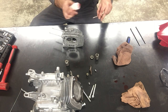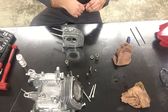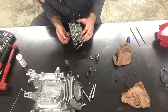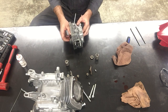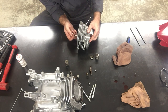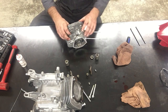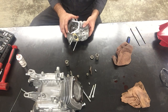That's one valve, and I would want probably both valves to feel around the same. If you don't get that feeling with your engine, it's probably because your valve guides or your valves are worn. Now I'll slide my exhaust valve into the exhaust valve guide, and everybody here could hear the little noise it makes.